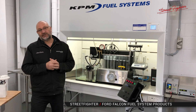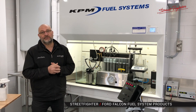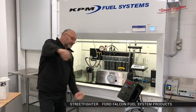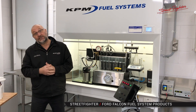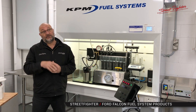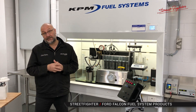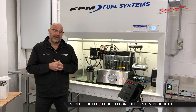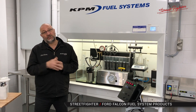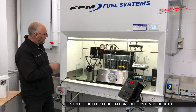We've tested this on racetrack to make sure that in real life it's actual and it works magnificently. We've carried out full circle, full left hand and right hand bends. We've actually done this testing — we've drained the tank on the vehicles, put five litres of fuel back in and done the testing on the racetrack with a race car driver, with full g-forces, and we've tested the system until the car ran out of fuel. The vehicle did not surge for the whole period. Empty fuel tank, full module.